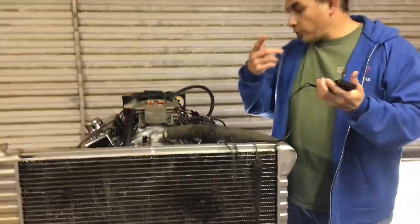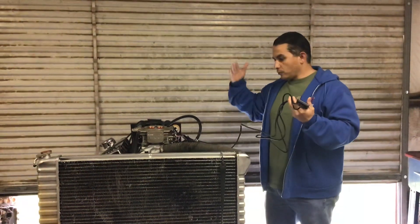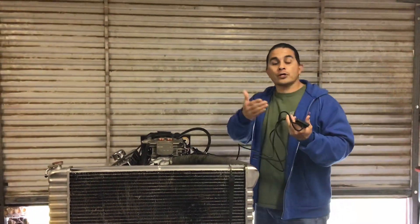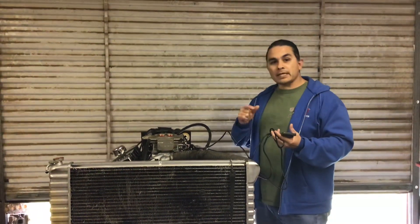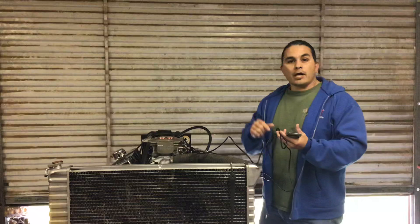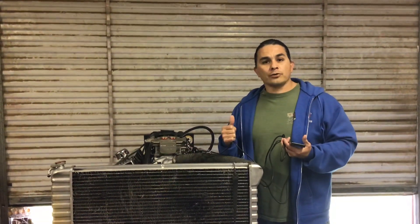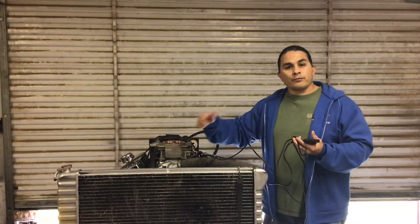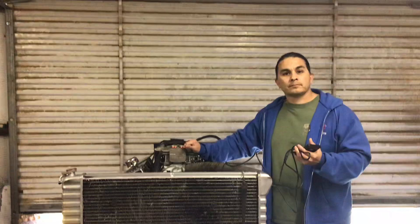And that is basically how you set that up. You're going to continue doing it — whether adding or subtracting — until you get it to where it won't kill the engine, but it idles back instantly, or however you like it. It's up to you how fast or slow you want it to idle down. Stay tuned and I'll show you another video on how to set your IAC, which should be anywhere from 3 to 10. If you haven't subscribed, go ahead and subscribe — thanks for watching, I'll see you in the next one.